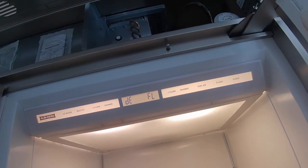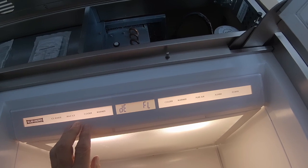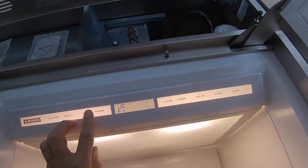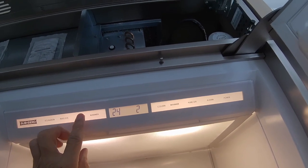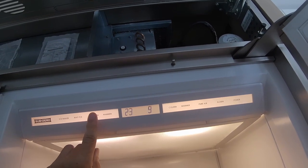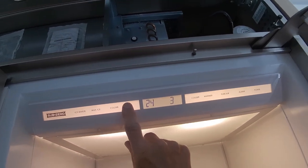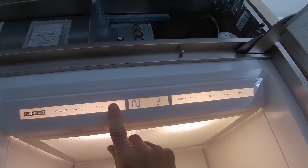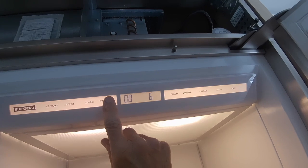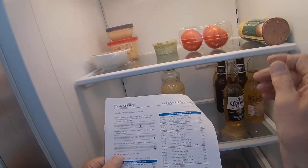For example, for me, for 007, I'm touching the colder key but I'm going the wrong way because there's a lot of codes in there. I need to go to 007 — I'm going down but I want to go up. So I'm going to touch the warmer key and now I'm going back the other way because it's a shorter distance between DEFL and up to 007. Once you get to 007 or your code, once the code is set, press the power key.